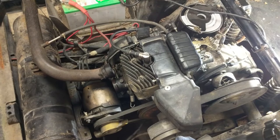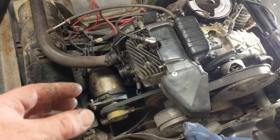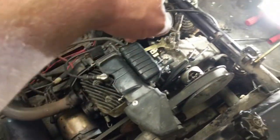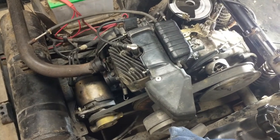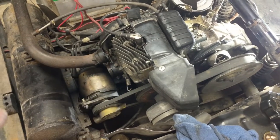This belongs to a customer and they were telling me they couldn't get it running. I've deduced that the exhaust is plugged because when I put the exhaust onto this thing it won't run — it just fires exhaust out the seam where the two connect and nothing comes out the tailpipe. When I disconnect the exhaust it fires right up.